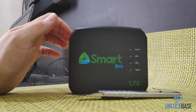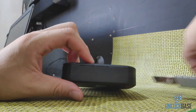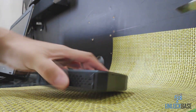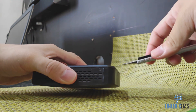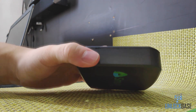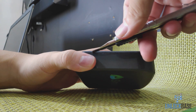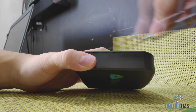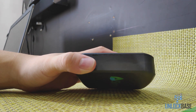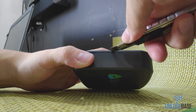You're gonna need your box cutter or blade and that thin piece of plastic. Go on this side and shove your cutter in there gently at a downward 45-degree angle. I would start here in the middle because right here you have the internal antennas, and you don't want to damage them just in case you want to undo this mod and use the internal antennas again. So start here in the middle and go downwards.